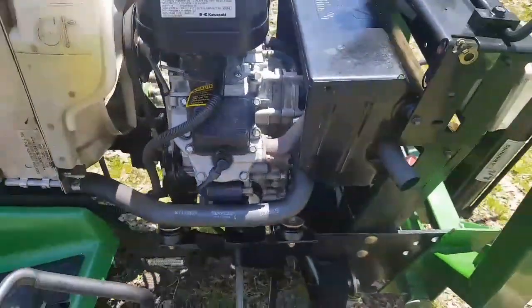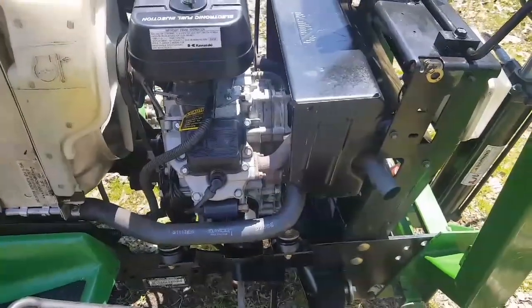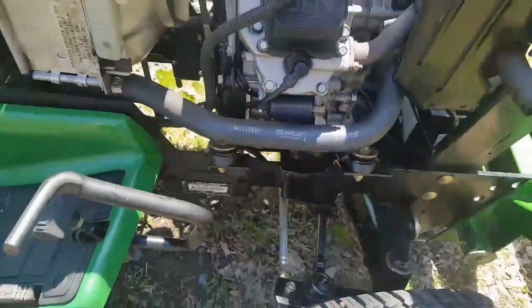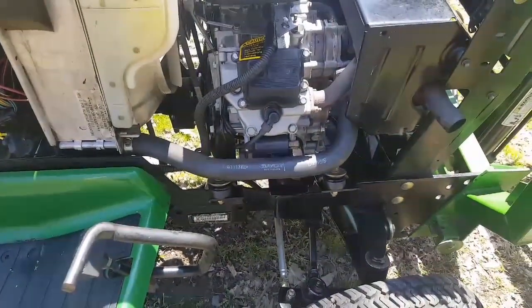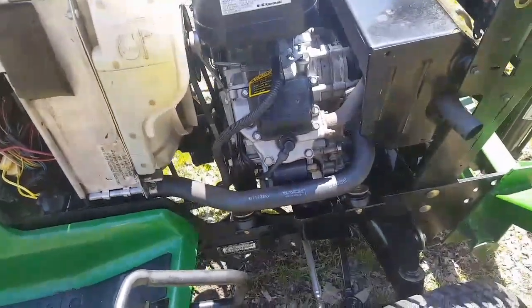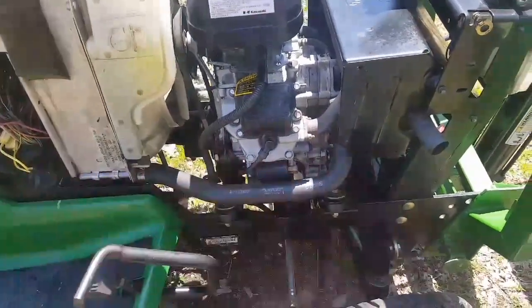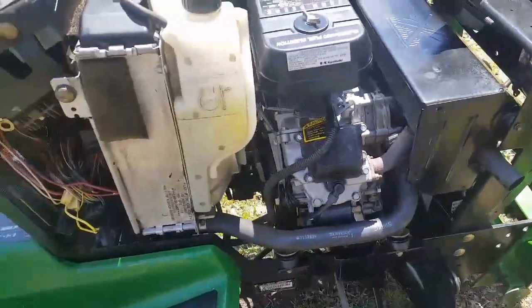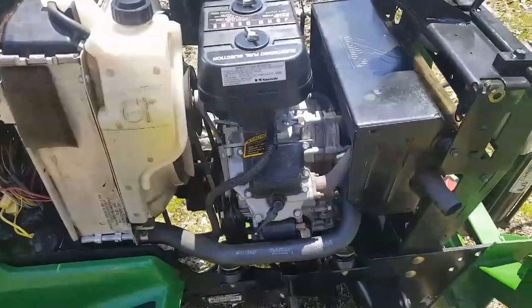I was using a non-John Deere oil filter, which cross-references for this engine, but it had a different fitment and it was leaking badly, even though I'd tightened it up, I think, appropriately. And also the oil pressure sensor down there, I'd used some kind of gasket cork on the threads, instead of Teflon tape, and that was leaking too. Took that out, put some Teflon tape on, put a proper oil filter on, drained some oil to do that, topped up, and everything is good.